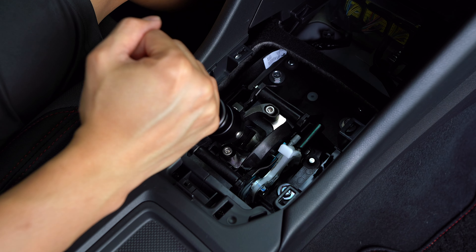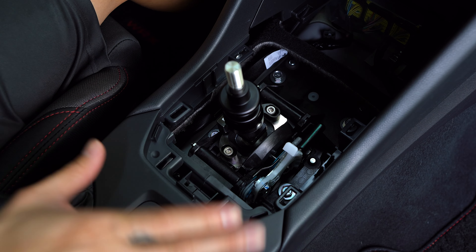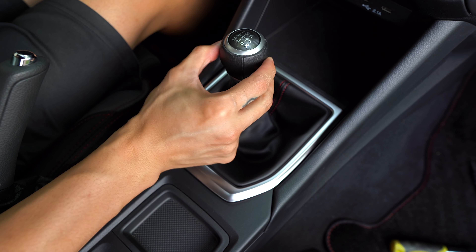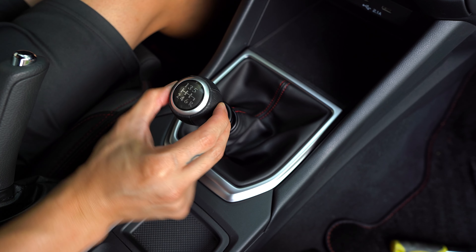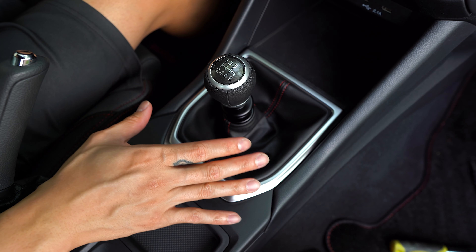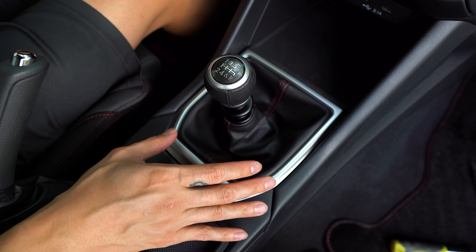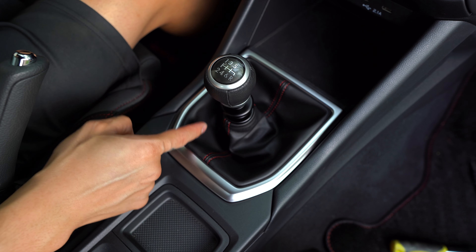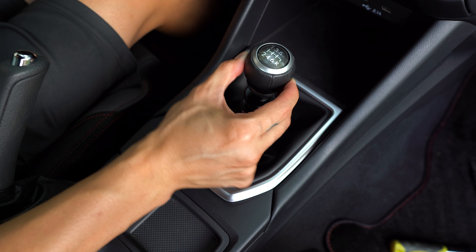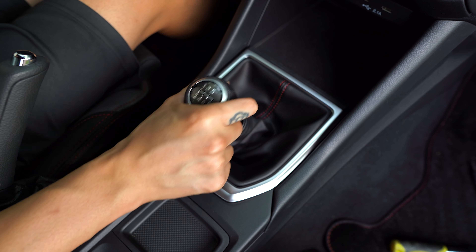Make sure you can get into every gear — you may need to make adjustments to dial it in. Let's see how much movement there is now that we've installed the shifter stop. Going into first — a whole lot less. Same thing in second. You can actually adjust the shifter stop so there's virtually no movement, but I wouldn't recommend it because those two metal pieces would always be in contact with each other. So I did leave a little bit of a gap to prevent that. The same thing goes for the OEM reverse lockout for fifth and sixth — I adjusted that so it cleaned things up and it's a whole lot less sloppy. Overall, the shifter feels much, much better.